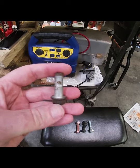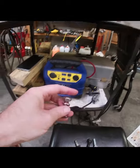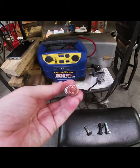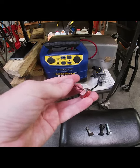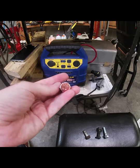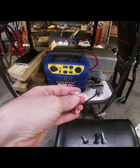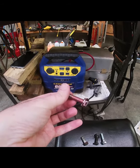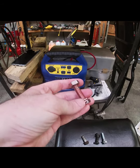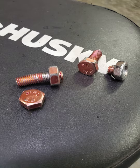So I thought I'd just go to a local hardware store and pick up some bolts. I grabbed them because they say 8.8 on the end, and I didn't know that metric bolts are graded in class, not in grade — and class 8.8 is roughly the same as grade 5, not grade 8. So we put these in, and when we put 70 foot-pounds of torque on them, it started chewing them up, spitting out the washers, and pulling the threads. I actually broke two of them and bent one with just 70 foot-pounds.